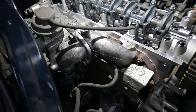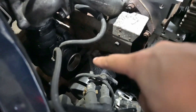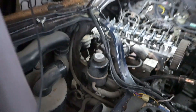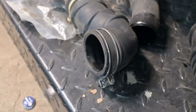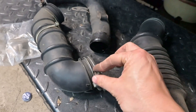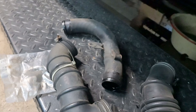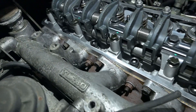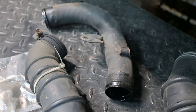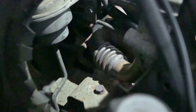There are some more pieces that you need to take off. We don't actually have our whole intake system here anymore, so we need to take off three more pieces. First, we have the turbo inlet pipe — to remove that you've got one 10mm bolt here and another 10mm at the top, and you can pull it right off. The next piece is this metal pipe that runs over top of your intake manifold, taken off with two bolts located here and right back there. Lastly, we have our connection pipe that runs through this hole and then to our air filter box.